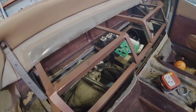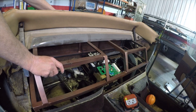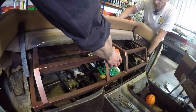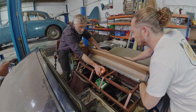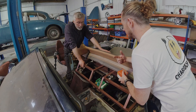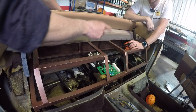In the back, we're working out exactly where to put the contactors and the service disconnect. Basically we're going to have the contactors in there, the pre-charge resistor, the main fuse, and your isolation manual service disconnect — either here or possibly there with a plate over the top of it. So that in the event of some sort of mishap or if you need servicing, this can be removed and that will disconnect the main power feed from this battery. We're going to have a disconnect on the front one as well — both battery packs need to be able to be isolated. Both will have contactors, but only this one will have the pre-charge relay, because they're both in series so only one of them needs to pre-charge the system.